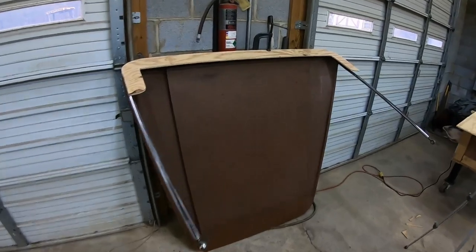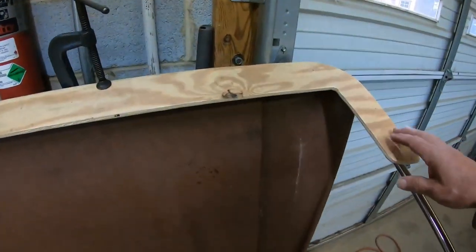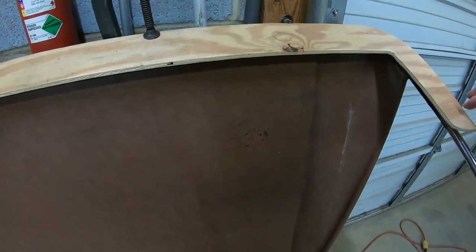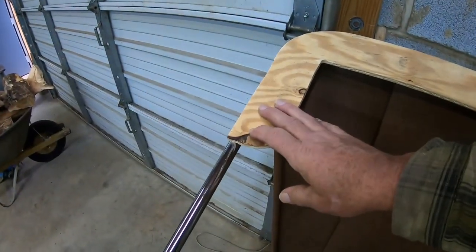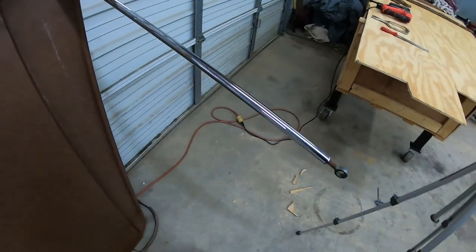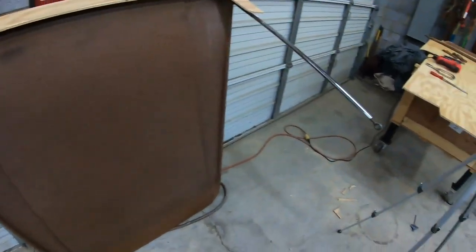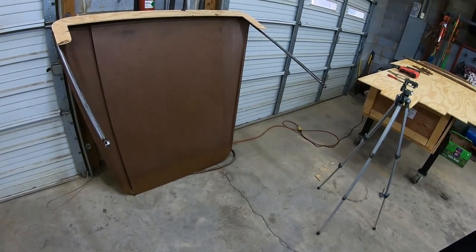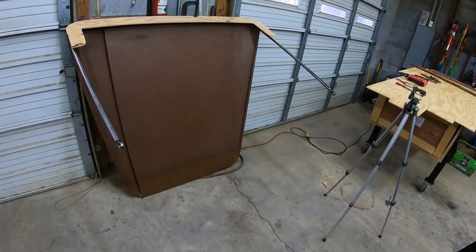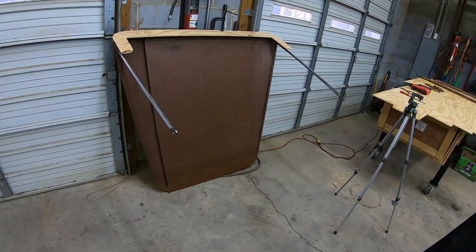I got the piece cut out and I put it on there. This is going to be looking at the back of the roof — the top back. Once he wraps this with material and we rewrap the whole roof, this is going to get screwed down with sheet metal screws into the tubing all the way around the edge to hold it down. Then there'll be another piece of material that goes over it that tapers down on both sides of these posts and snaps onto the body — it's kind of hard to explain, you'll have to wait until I get it on there to see what it looks like. Everything went pretty good so far. I appreciate everybody watching — don't forget to like, subscribe, and stay tuned next week. I'll see if Ronnie will let me do some video down at his shop when I drop this stuff off, and we'll continue the video next week. Thanks for watching.